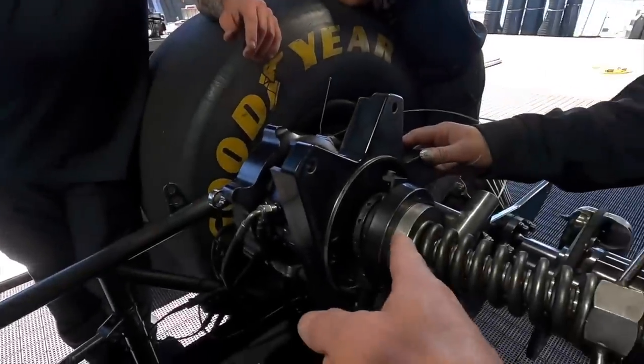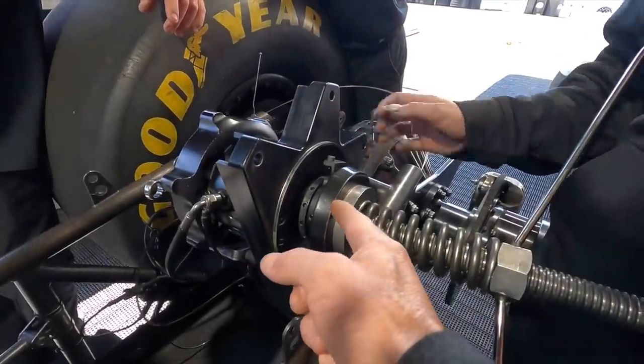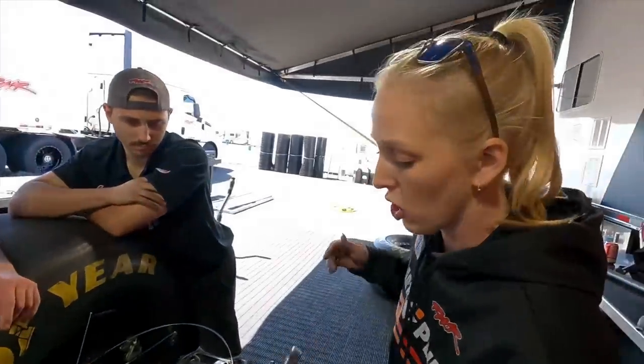You put pressure towards it because you got to think of the clutch. You got the primaries and the lockup levers applying load, and that's what we're doing here. With big spring, now we crank to 300. Basically, it just simulates the run. So, Kaylin, all the levers are against this right here. That is correct, yeah. So if we back this off, you can see it a little clearer.